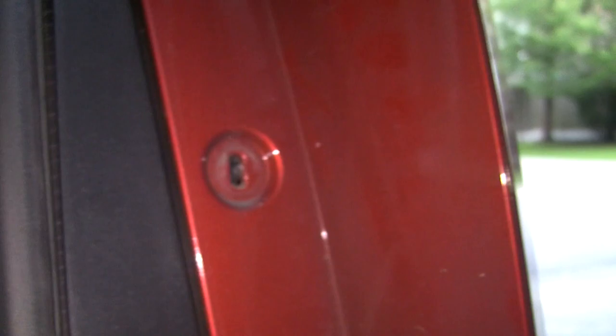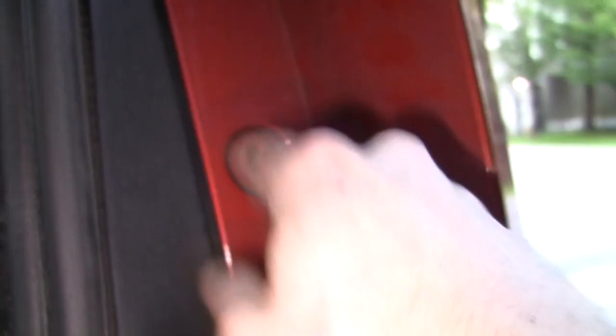A couple of top tips. I made the mistake of putting this screw in before putting the bumper on, and now I have to take the bumper back off to get that out — whoops. Second, make sure you thread these in the license plate light holes before closing it up, otherwise they'll be way down in there and you won't be able to fish them out. Finally, make sure the little gaskets are around the ultrasonic sensors — mine was missing one from before, which is not good, and some of the others fell out during disassembly, so make sure to pick those back up.